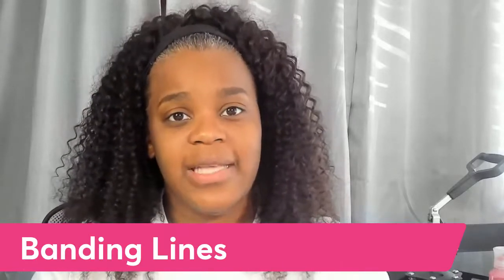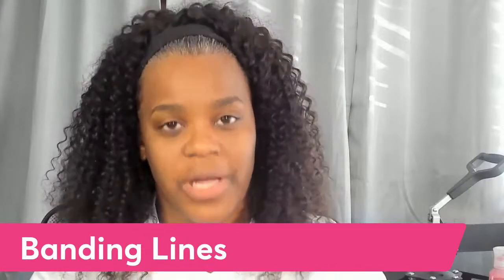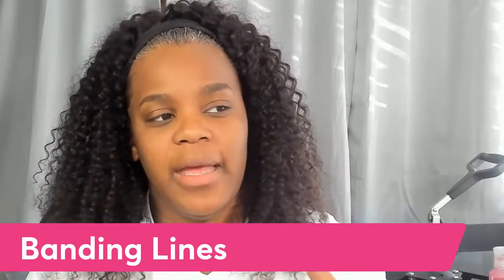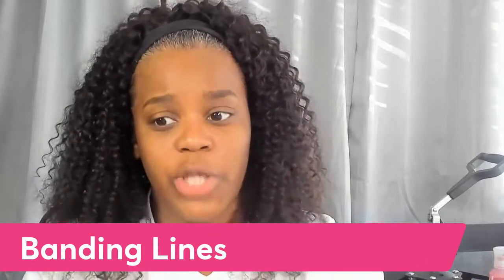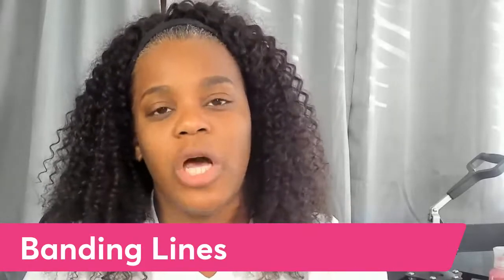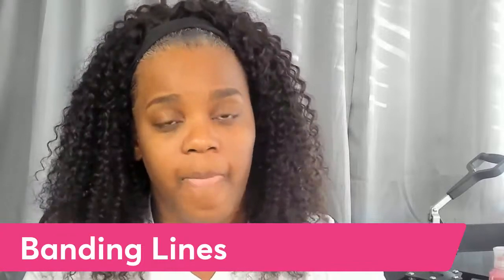What this does is it tells you the current state of your print heads. If you do a print head cleaning, that probably will correct it, but then you won't really know why it was doing that. So you have to do a print head nozzle check, not a cleaning. It will tell you the state. It's going to tell you which colors are off.